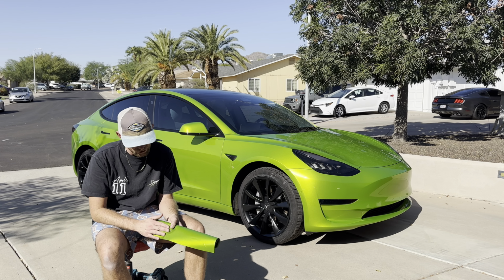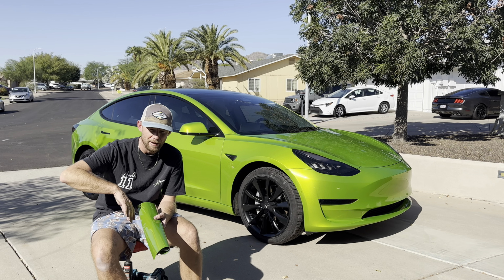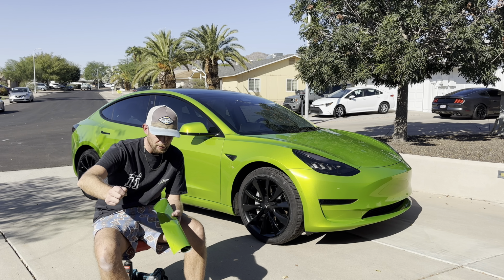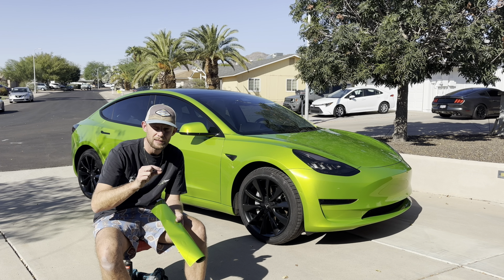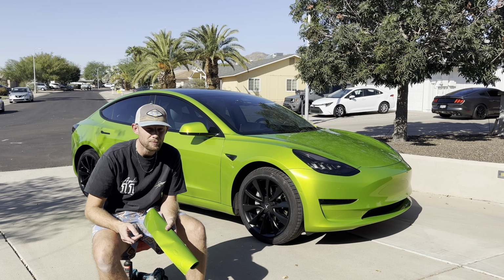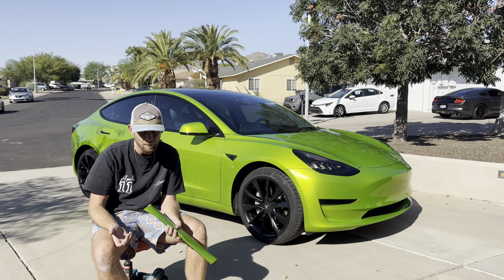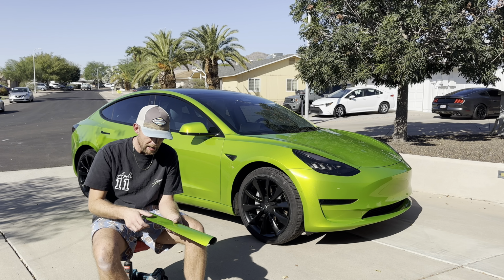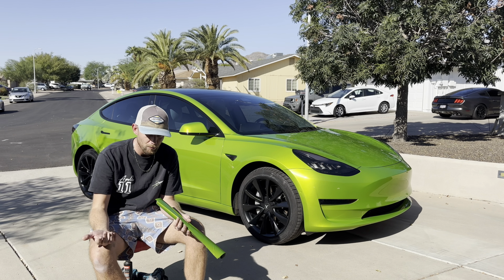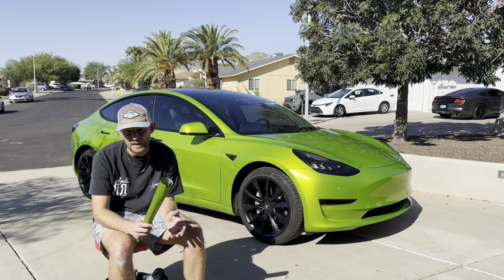The other thing is that the surface is super tacky as well. Even when I would wipe the surface down, I tried to do one panel where I put masking tape on the film, and as I peeled up the masking tape, it left a bunch of tiny little dots and weird glue lines. They ended up going away over the next couple days, but it was not ideal. So literally what I was doing is when I had to use tape, I would cut pieces of the film and use this as tape. Like if I had to cut on a panel, when I was peeling this off, it wasn't causing any damage to the other panels. So I'd be careful about using any type of tape on the film.